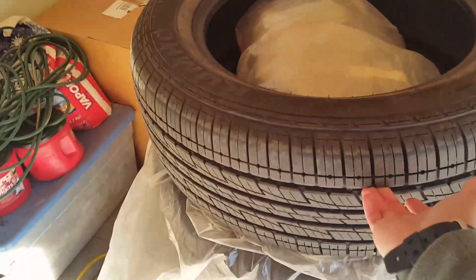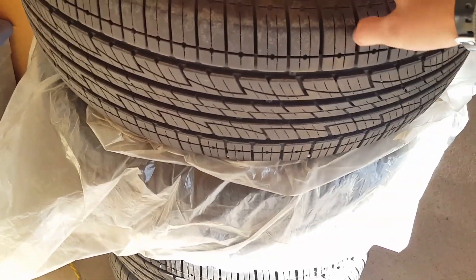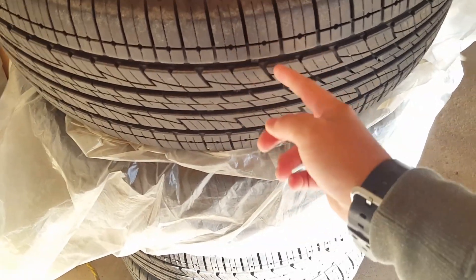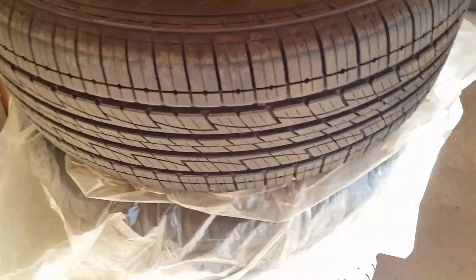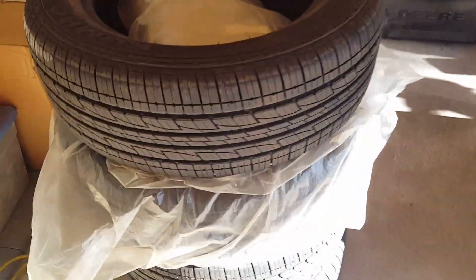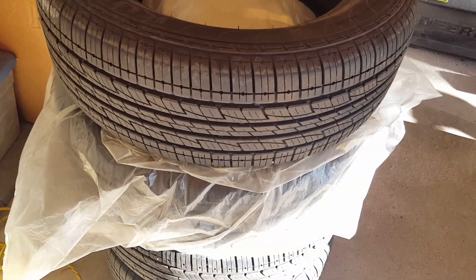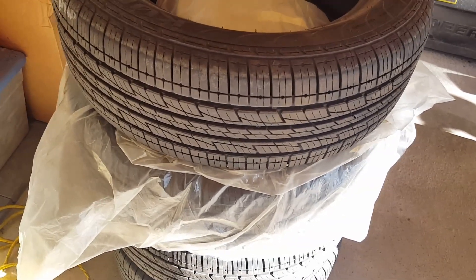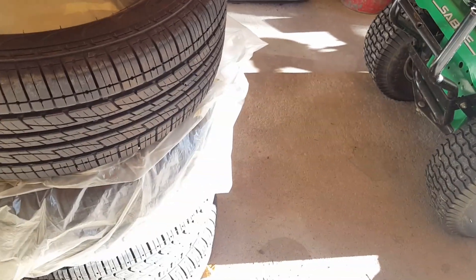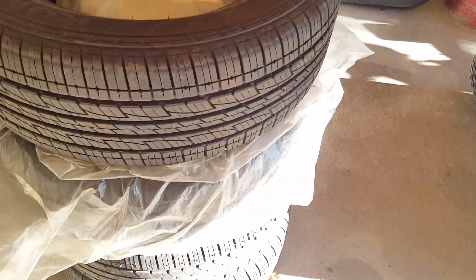There's not a lot of give between the tread. They work well in the winter because of all these cross-hatches — I guess they're called sipes, these small lines that go across. The more of those you have in your tire, the better the winter traction. But up here in New York, winter tires are great. The all-terrain tires work just as good for most cases, not all. Actual traction and stopping capabilities are better on a winter tire, but if you're trying to get through the snow, an all-terrain or snow tire is much better.